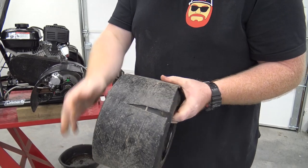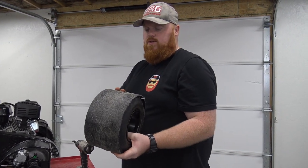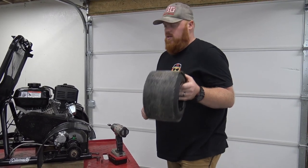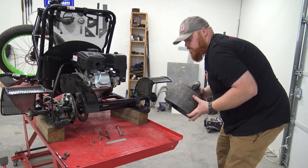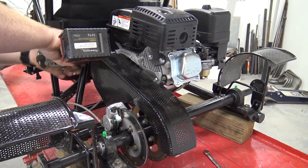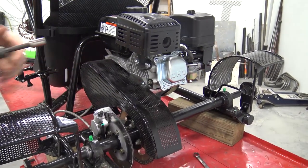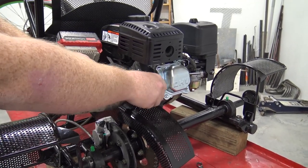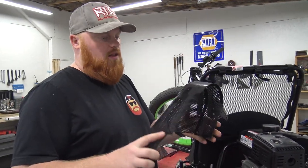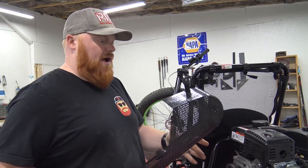As you can see, we split it there and almost all the way across as well. So we really put a hurting on these. These are four and a half inch wide wheels, so we're definitely going to go with bigger wide wheels and a little bit taller wheel — I think it just fits this drift track better; these are a little bit too skinny. Now we can remove this chain guard with an 8mm in the rear and two 10s on the front. There is a metal spacer behind the bottom bolt on the front of this chain guard. That's actually made a little bit better than I thought — it's pretty decent. This will be in the parts sale we're going to have soon because I like the Go Power Sports one a lot better.